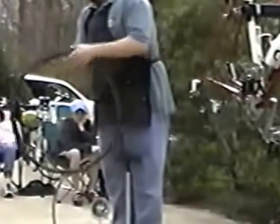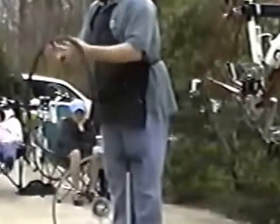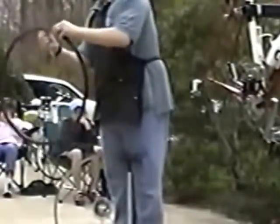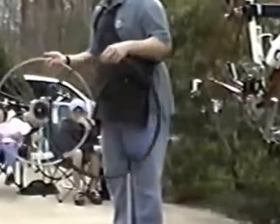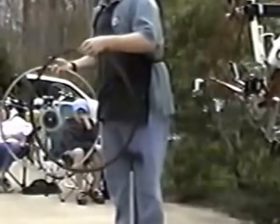Now, this is one way to install a tire and tube onto the rim. In my opinion, it's quite easy to do. Insert the tube into the tire, like this. That's one reason why we give it a little shape, because if we didn't, it'd just fall out. Now, you want to take your rim, and just like when we took it off, we took off half the tire first and then we took off the other half. We're going to do the same thing, putting it back on.